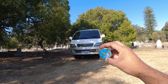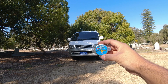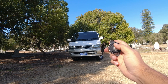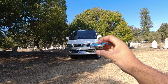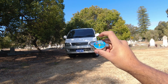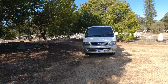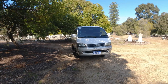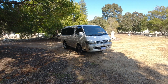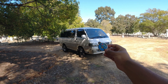A couple of months earlier I had pulled out the radiator cap that was on the car when I got it. It's got Japanese writing on it, so it's obviously from Japan, and it's in really good shape — the seals are nice and soft, no more than three years old. It was working fine, but the problem is it's too low a PSI for this car. After some googling I found that these cars ran a 13 PSI radiator cap until August 1996, and this is a 1997 — so this was the wrong radiator cap for it.